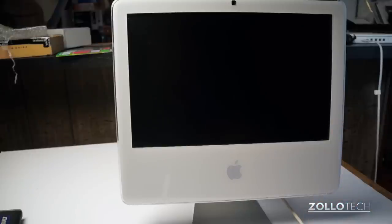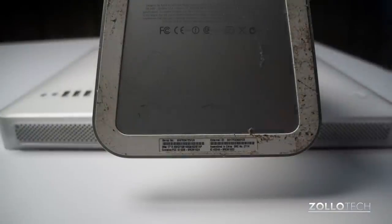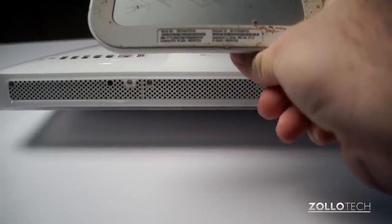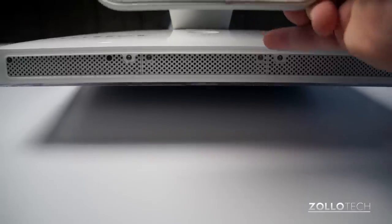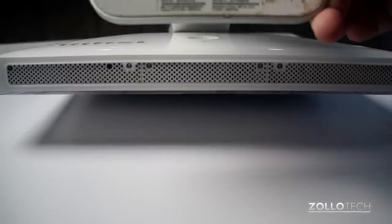The first thing I'm going to do is lay it down flat. Now the first thing we're going to do is use a Phillips screwdriver to remove the screws here in the bottom that you can see. There's a few of them across the bottom — there's one on the memory door and then there's a couple on the sides. These are Phillips head and then we have Torx on the side, so we're going to remove those first.